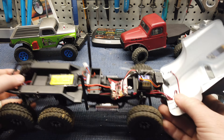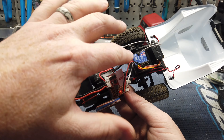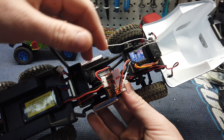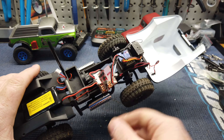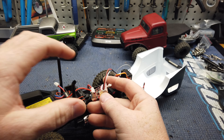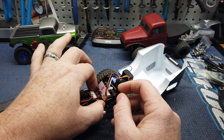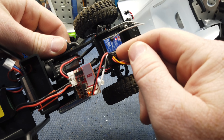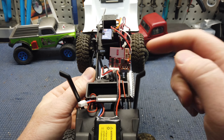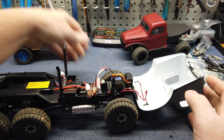So we have this installed. Here's all you're going to be looking at. You're going to have your receiver somewhere. Your FuryTek ESC with the cord it comes with plugged in here, running into channel 2 for your throttle. Then your battery straight in. Motor straight in. And you're set.